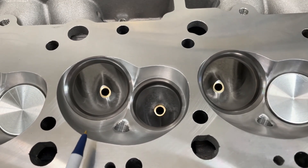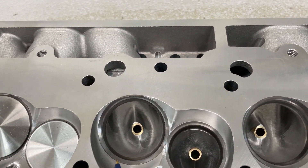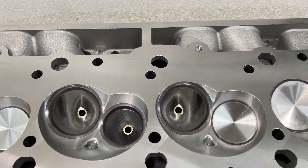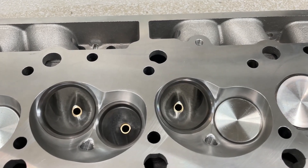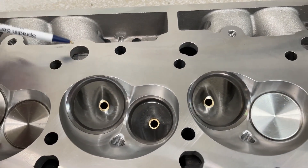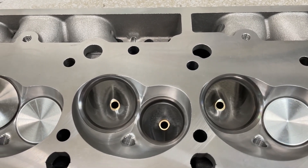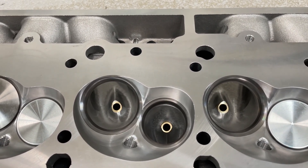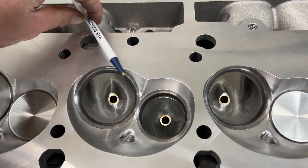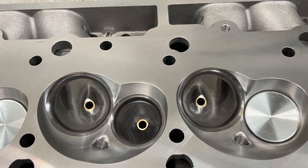This is the long runner and this is the short runner. As I'm flowing the heads I'm going to show you both numbers, because most times people only advertise the flow from the long runner. The long runner is longer than the short runner on the big block. Everybody tries to get the flow equal, but on a big block head this runner will never flow the same as the other one — they can get close but never the same. It's not like your small block Chevy, LS heads, or Ford heads where they're all pretty close. The long runner usually flows better because of the way it's shaped — it aims toward the center — while the short runner aims toward the wall and typically doesn't flow quite as well.